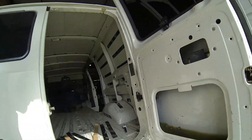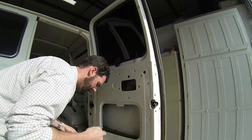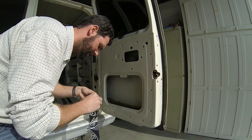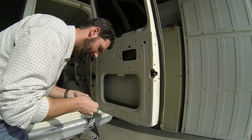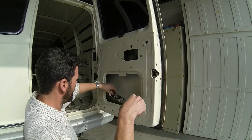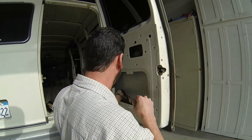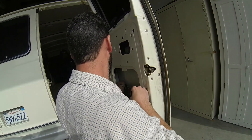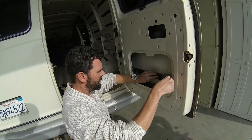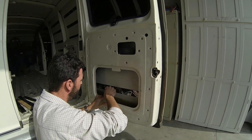So what we're going to do is put some Dynamat in here, and strips in here — get it out nice. The paper tore a little bit, but it's all good. This is Dynamat Extreme — this is the door Dynamat kit. Get it from one edge together. Pretty simple stuff, easy to apply. Use the roller, get it rolled down.